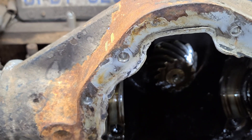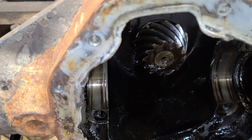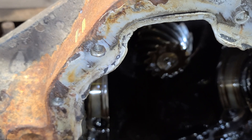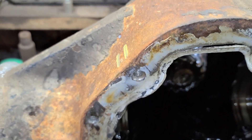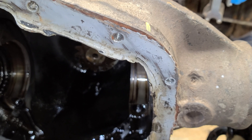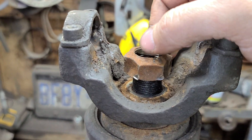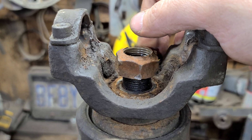I should mention this is not a tutorial video on how to rebuild a Dana 70 — it's my first time rebuilding one of these. I rebuilt a Dana 60 a couple weeks ago and learned a lot about it. Make sure you mark your carrier caps when you pull them out so you can put them back in the same spot — don't get them mixed up. I loosened the pinion nut off; I don't think I've ever seen a pinion nut look that bad.